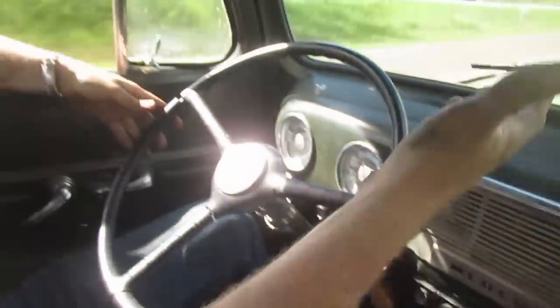What's the rear end in this thing, do you know? It's out of a 64 Ford actually, so it's a decent gearing. It's 350. Okay, so that's perfect for driving around. They probably would have had a 4.11 originally, and it was awful. You can't use it very well. Tried to make it slightly more drivable. And it goes down the road pretty straight.